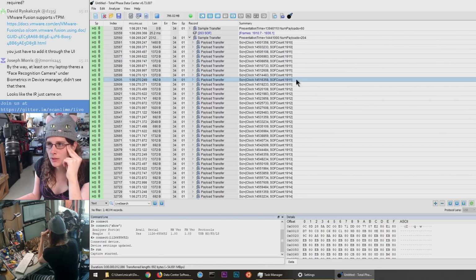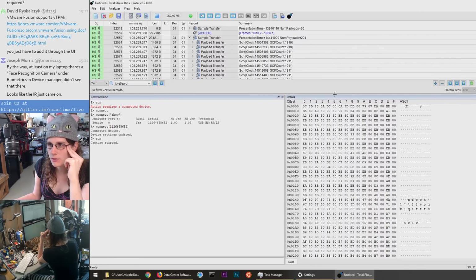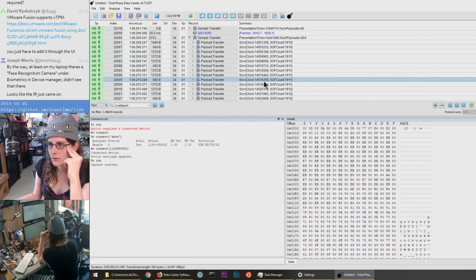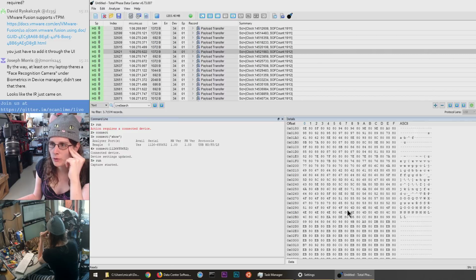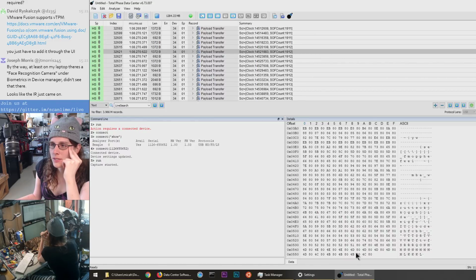That's interesting. So all of these would be within the same millisecond. So this seems like these are not video frames, but parts of video frames. Are these just individual isochronous packets? That looks like an individual isochronous packet. This looks like uncompressed video. I'm just saying that because if it was compressed, you would not see runs of almost identical bit patterns. It looks maybe like this is a 16-bit value, or it's an image interleaved with something else that's typically constant.